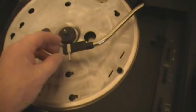I'm going to try and pull that top one off. That's really tight. Try the speed one — that's not coming off either. The stylus drop one is coming off. I'm going to have to do some persuasion on these ones, but we've got them off. What we'll do next is raise the stylus up and move the arm across to the centre of the turntable — that keeps the stylus off the metal, but the arm's got to be in that position to get the deck off. We've got another screw right down here in this tube — got to take that one out.